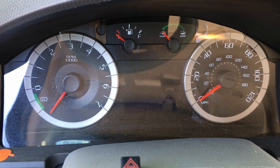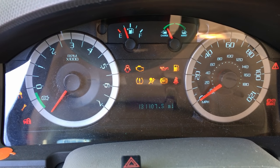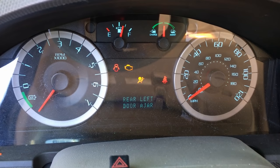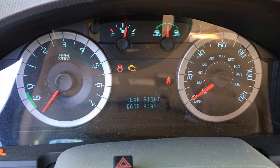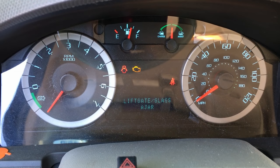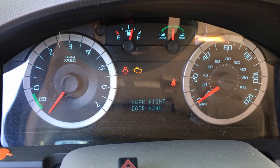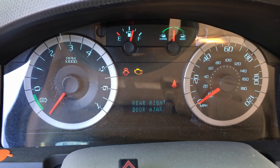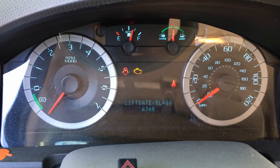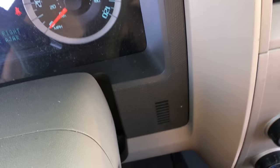Here's the way you want to test the ignition lock module: take your key, put it to the run position, verify there's no theft light blinking, everything looks good to go and powers up. Then turn it to the start position — nothing, the vehicle did not start, as you can see by the RPM gauge or the ready-to-drive mode indicator on the hybrids.